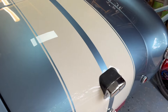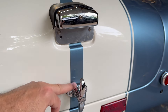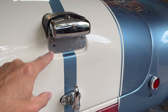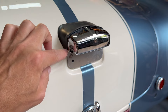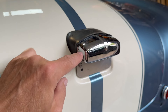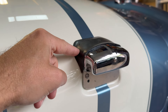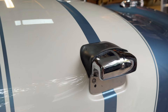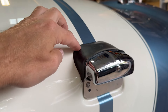Another directive is that you need enough space shown for a standard size number plate. With the light in its normal position it wouldn't fit, so AK's pack includes a number plate light that raises up. Unfortunately that was all booked out, so I've made my own - a sheet of metal with the light on it. I cut out a triangle of foam behind it and coated it with P38 filler, then stuck a bit of two-mil rubber over it so it looks like it's moulded into the body, with no sharp edges.